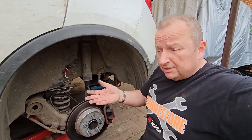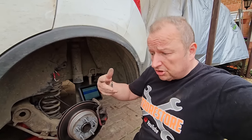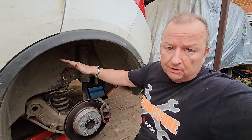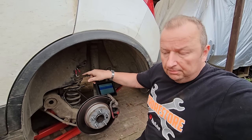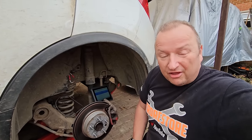To confirm further, I've shorted out the left sensor cable and erased the codes on the reader. If the cable is continuous with no break it should show short circuit — but it's still saying left speed sensor low voltage, open circuit. So somewhere between the wheel arch connector and the VCU there's a break in the cable. We've now concluded the sensor is okay, the hub is okay, and the fault lies in the wiring loom itself.